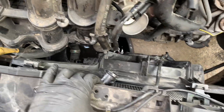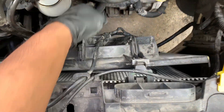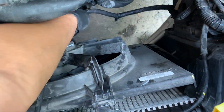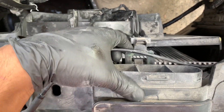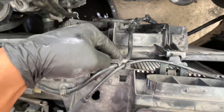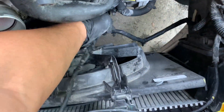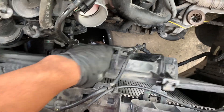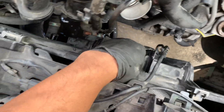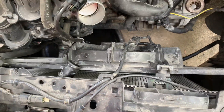So I've removed both my radiator hoses — you can see the coolant drained down there. I also pulled the tabs off the wire harness to the fan and separated it from the radiator. All you have to do is pull these tabs up — one on each side — and just pull forward. Now I'm going to pull this fan up and get ready to unplug it, bringing it straight up like so. We're also going to be replacing this fan, so I'm going to work it out and get it up.